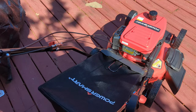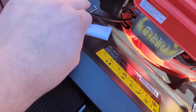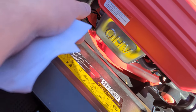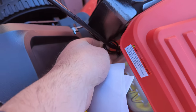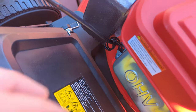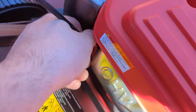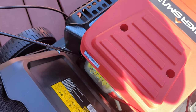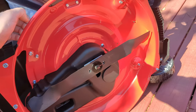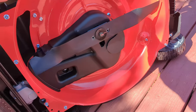When you pull the handle down, this is your throttle cable — the throttle line going right down in here. Check it once in a while to make sure it doesn't come out and rub against the hot engine parts. What you can do is bend this protective guide up to protect it even better — I personally recommend bending that up so it stays away from both sides. For those who want to see what it looks like underneath: I do not recommend doing this unless it's completely empty of oil and 100% empty of gas, but this is how it looks underneath.